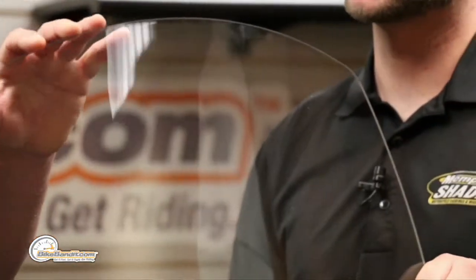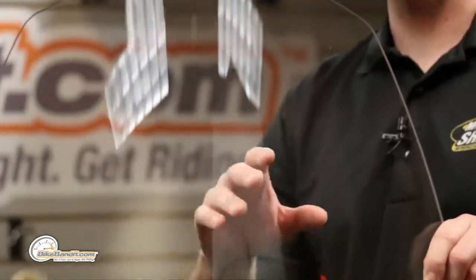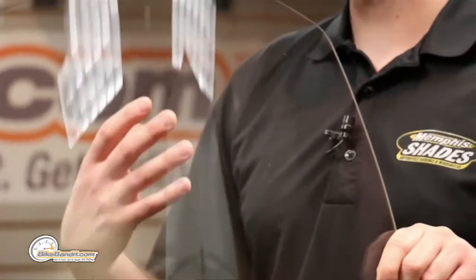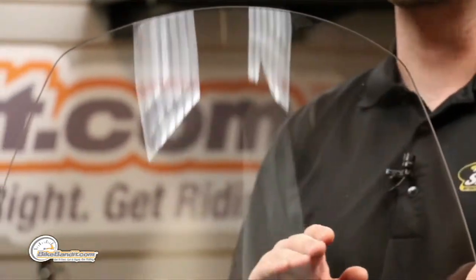And the materials used to build them? This is Lucite acrylic — Lucite's a brand name. We use a little bit different material than a lot of other manufacturers. A lot of other manufacturers are going to use Lexan, which is polycarbonate. It's very soft, so you have to hard coat it. Lucite acrylic is very hard and very glass-like. The optics are very clear — you don't have any kind of distortion in the product. Because it is so hard, it requires no coating, so down the road you're not going to have anything turning yellow or peeling. The best feature I love the most about acrylic is that because of its hard nature, if you get a scratch in it, you can use Novus No. 2 and polish that scratch out. I've seen people come to me at the Sturgis rally, Bike Week, things like that, and I'll say, is that a new shield? No, this shield's been on the bike for 15 years — so it's really easy to keep these things looking great.